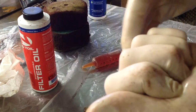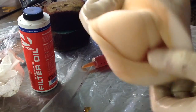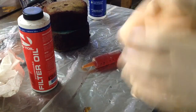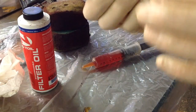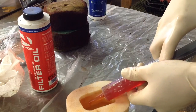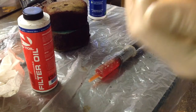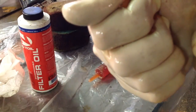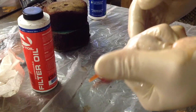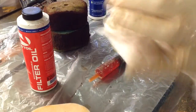Right now looking at my knuckles I'm not quite getting enough, so I'm going to put a little bit more on. This is pretty nicely covered — you can look inside and see it's worked its way all the way through. That was with about half an ounce of oil on a brand new white filter. I'm putting just a little more so I can see it coming through my knuckles. Once again, it doesn't take very much — now we've got a little over half an ounce. Just work that through. You can see the oil just beginning to squeeze out, and that's excess oil — you don't need that on the filter.